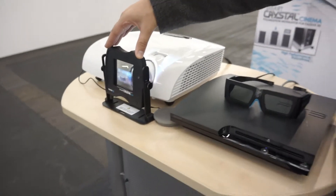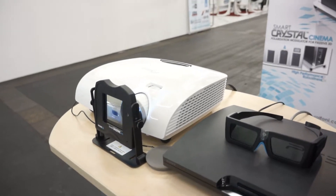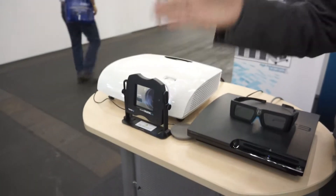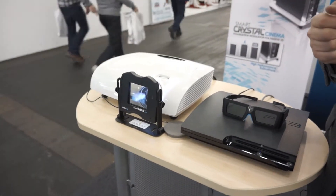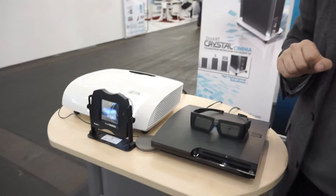Just to clarify — you do still need a 3D-capable digital projector? Yes, you need a 3D content source, which means a special 3D film or an architecture program providing 3D images through the PC. It then goes through the 3D projector, and here with the Smart Crystal Pro, instead of obscuring the wrong images, we are changing the polarization left and right on each image.